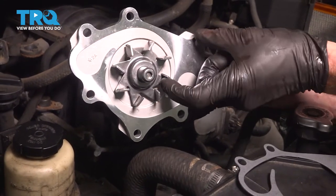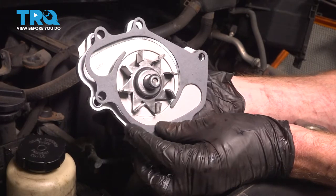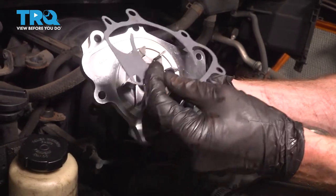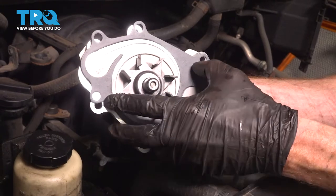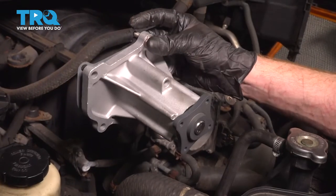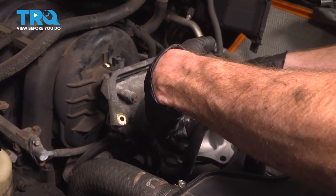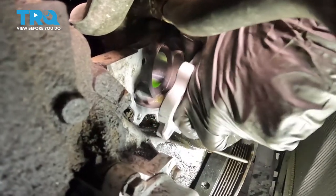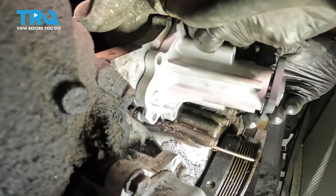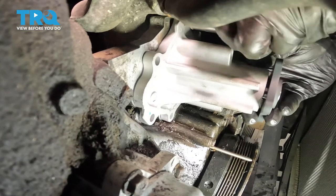Let's have a look from the backside — that's the side with the impeller. Take the gasket and put it in position so you know that all of the mounting holes line up. If you put it backwards, the holes will not line up and that's going to give you an issue putting it on the engine. Once that's on there, turn it back around. Take one of your mounting bolts and slide it right through that gasket — that'll hold the gasket in place while you continue putting the water pump down towards the engine. Once we get it down there, we'll start in all of our mounting bolts. Never tighten any of the mounting bolts before you start all of them in.